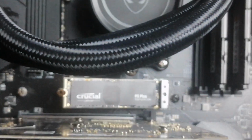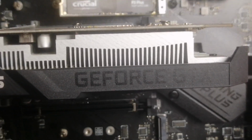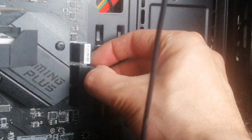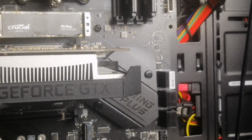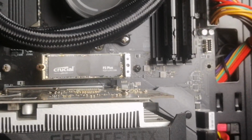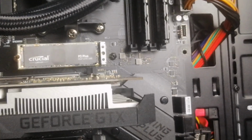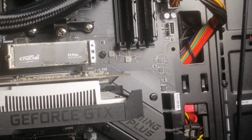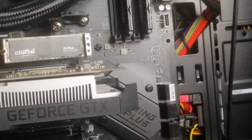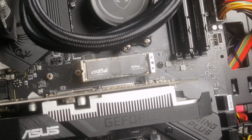And I'm going to disconnect my source disk. There we go, just to make sure that I know it's the right one. It's been successfully booted up from the clone drive, because obviously we all know that both drives contain the exact same data, so there's no other way of knowing. Or you could even do it in the BIOS, but for quickness, I'm just going to do it this way.